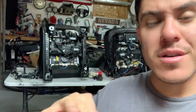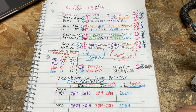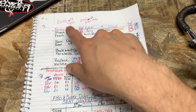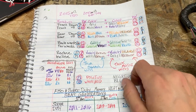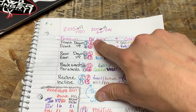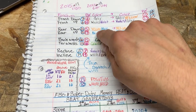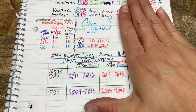Now let's talk about the third gens — they look like the second gens but they're not the same. Here's the wiring diagram. Basically, these are wires coming from the switch and these are wires coming from the motors — we just need to tie them all together because the memory module sits in between, and we need to get rid of that middle man. The red circles on the diagram are the pinouts for the first and second gens; the blue circle is for the third gens.